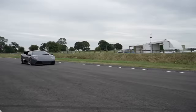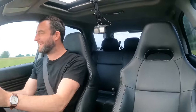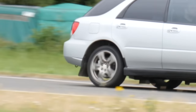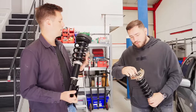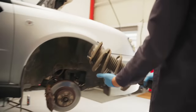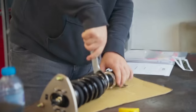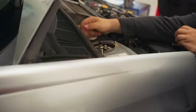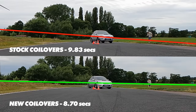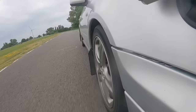The most obvious problem we needed to address was the suspension. The stock struts were dead and they were doing a terrible job at controlling the car's weight. It wallowed around the corners and the rear right damper was completely useless. We addressed that problem with a set of BC Racing coilovers for £995. They're stiffer and gave us way more adjustment when it comes to ride height, camber and damping. With nothing but a little adjustment of the dampers, the coilovers knocked 8 tenths from our lap time and also made it feel like a race car.